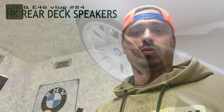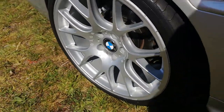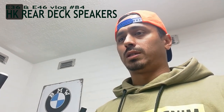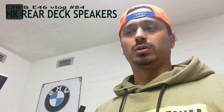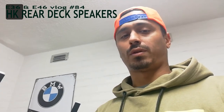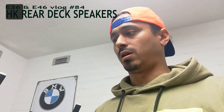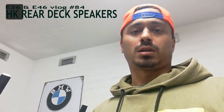Afterwards I cleaned the whole rim with a rim cleaner by hand and wiped it up with water. For the rough spots I used brake cleaner - be very careful with that because it's super aggressive and you don't want to hurt the paint. I also got the sticker material off because there are weights on it to stabilize the wheels. I now understand why mechanics don't remove the sticker leftovers - it's really irritating. I used sticker removal and some other stuff to get it off. It was almost a day's work to get all the rust off and all the sticker material, but they're on.